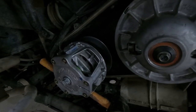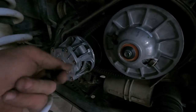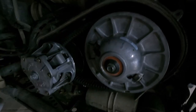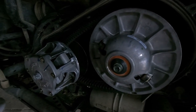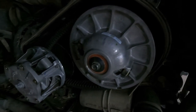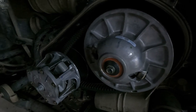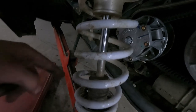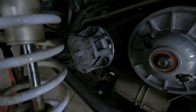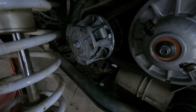Now you are ready to put the belt on and then put the clutch cover back on, and then move on to your ECU. To get your belt on, slip it over your primary and then start it on the top of your secondary, and then turn your secondary. If you need help turning that, you can use your tool or do it by hand once the belt is kind of started on there. Open your sheaves with your tool and pry that open and it should go a lot easier. After that, put this shock guard back on — I had to take that off to get at the primary bolt with an impact; if you do it with a ratchet you probably don't need to take that off.